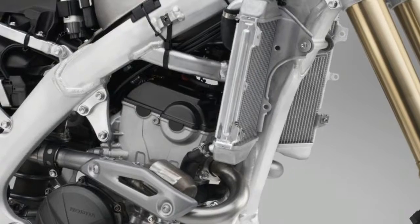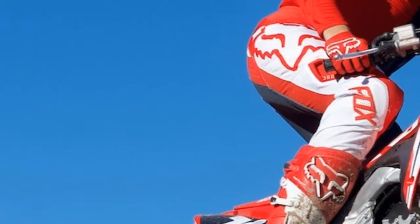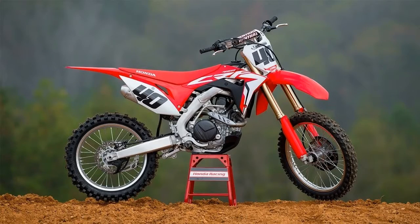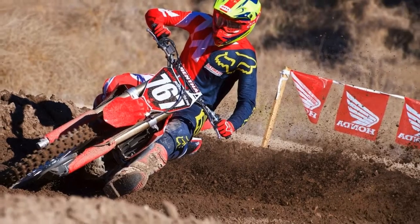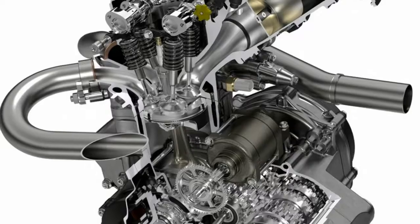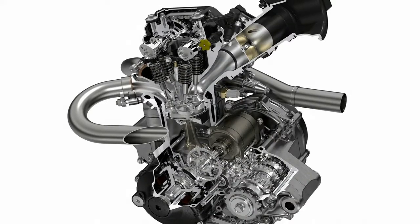Aside from having a better feel on the track, and unlike the fork on the 2017 bike, the new fork is easy to dial in with no air pressure gauges necessary. The shock has a plush feel that absorbs everything well. Honda recommends 105mm of sag as a baseline setting, but the bike seems to work better with a little more sag. I went as low as 109mm on the recommendation of one of the Honda technicians, which made the bike feel more stable at high speeds. Overall, the new Showa suspension components are a huge improvement over the previous setup and are a win-win in both the front and rear.